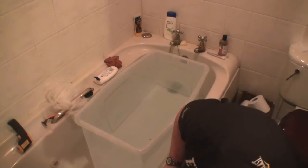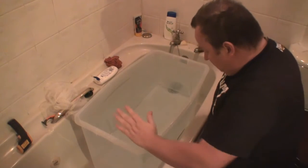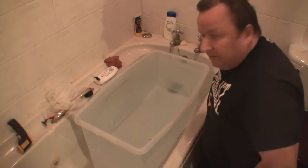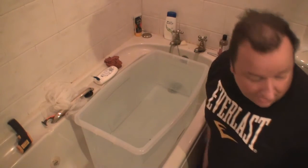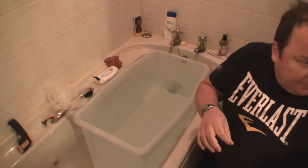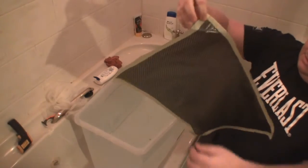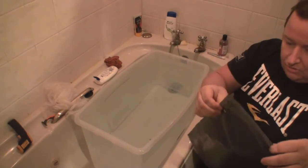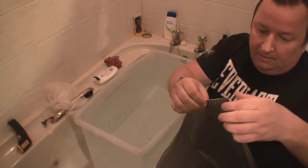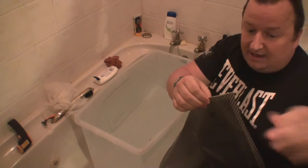This time we've got our mask for the activator, so we're going to spray with the activator. And now Jimmy's going to pass me. I've got Jimmy here again, by the way, you can't see him at the moment. So Jimmy's going to give me the first sheet, which we're going to do the clocks with, which is this one here. It's that way. Again, if you want to do a test to know what side to face down in the water, wet both fingers, touch a corner of it, and the bit that's sticky is the bit that faces down.